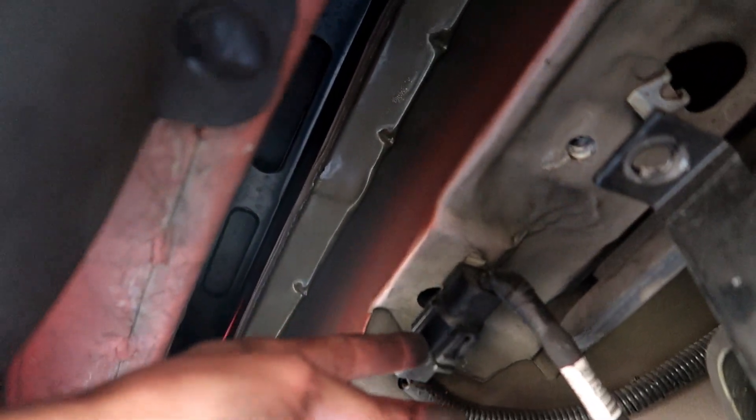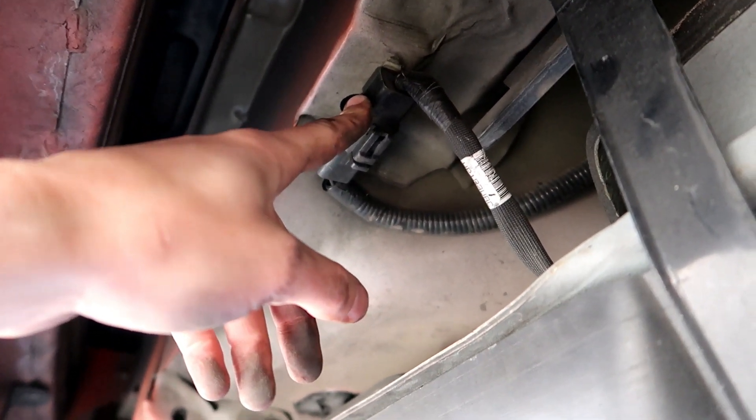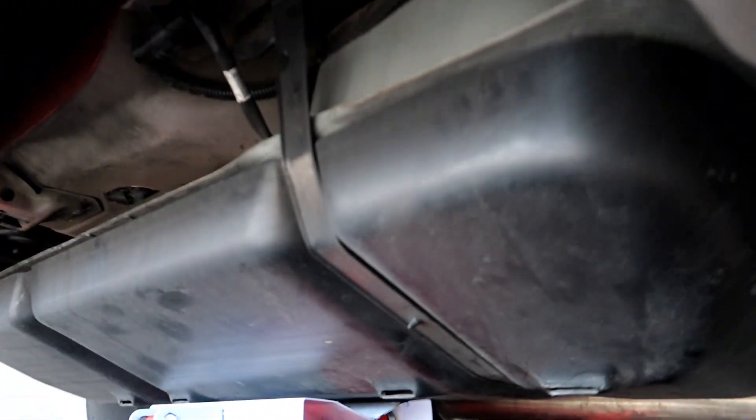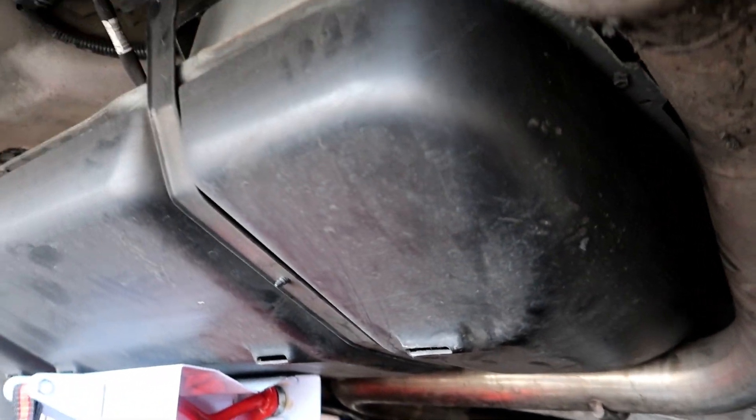I've got to disconnect this electrical connector here, which is pretty easy. The fuel feed lines are up over here - it's hard to see, I need better lighting. You can disconnect the line going into the filter on the right hand side and then drop the tank down, or you can do what I'm gonna do, which is drop the whole tank down and disconnect it from the top. So instead of trying to fiddle with that, I'm gonna drop the tank down, give myself some room - it'll also give me better access to the fuel filter and make it a lot easier.